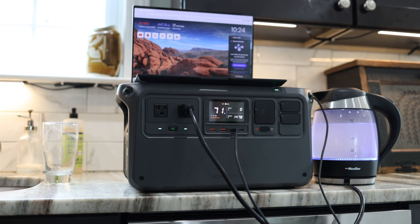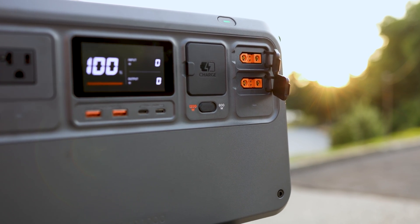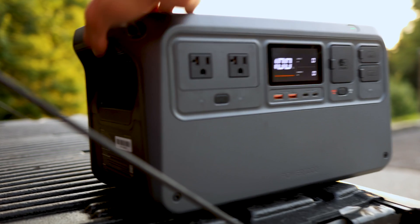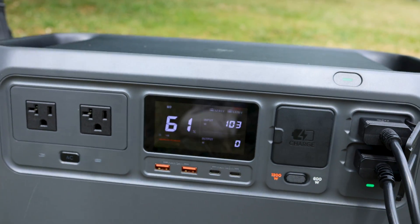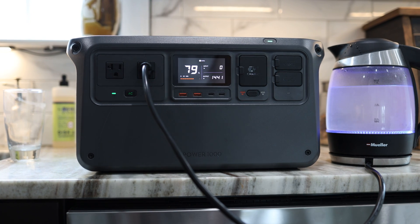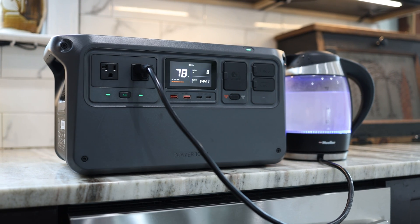Moving across, both use the same three-prong computer cable charging port. Next to that, kind of the star of the show for DJI, are their SDC ports — they have two: one SDC and one SDC Lite. At launch they're both the same, but a future firmware update may give more capabilities to the regular SDC port. These are both input and output, and you can get dongles to adapt to different use cases — a cigarette lighter or solar panels. Input is rated for 400 watts each, so theoretically up to 800 watts of solar input. Each supports 32–58.4 volts at about 8 amps. Outputs can each deliver 240 watts between 9 and 27 volts at 10 amps each.